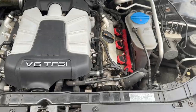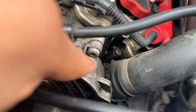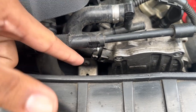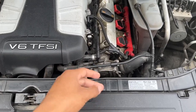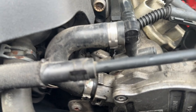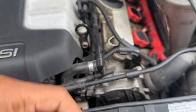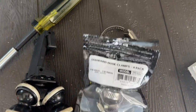Some Q-tips will also help you clean out the screws — this is literally all you need. Before I get into cleaning this off, let me show you what we're working with. There's one T30 torx bolt right there, one there, and one right below at a weird angle. Besides those three screws, there's also this hose right here that attaches to the vacuum pump — these hose clamps have to be pried off. Instead of buying the bow-tie style clamps, I just bought some regular twist-on hose clamps.